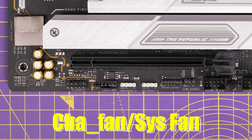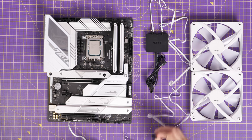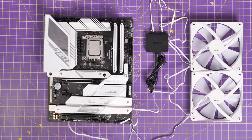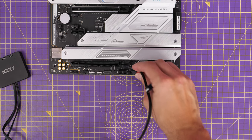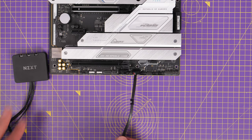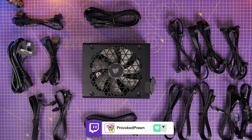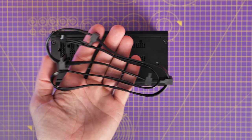You could get a Y-splitter or three-way splitter to plug those fans into a single header on your motherboard. But you can see that we're now using three potential fan power connections on the motherboard — one for the three front fans, and two more for the additional ones. The RGB connector plugs into the USB connection on your motherboard, which allows you to control the RGB lighting via NZXT's CAM software. You also need SATA power — those flat connectors from your PSU, like the RM Shift from Corsair I'm using here. These flat daisy-chainable connections power the RGB hub, enabling the RGB lighting on your fans.